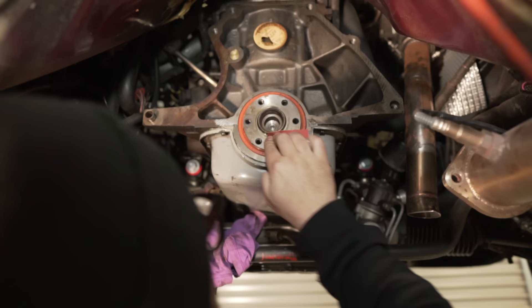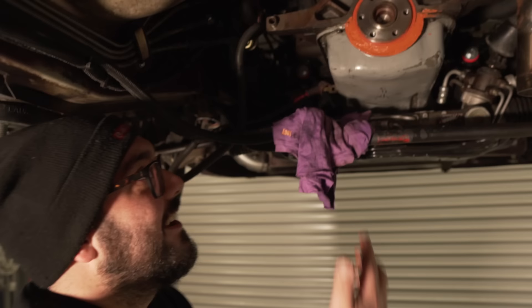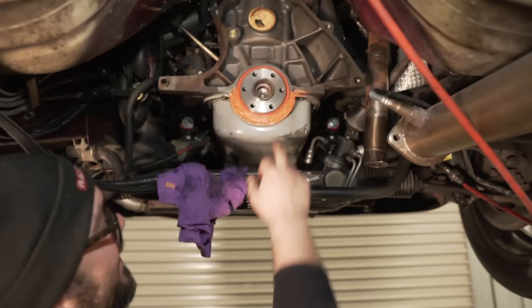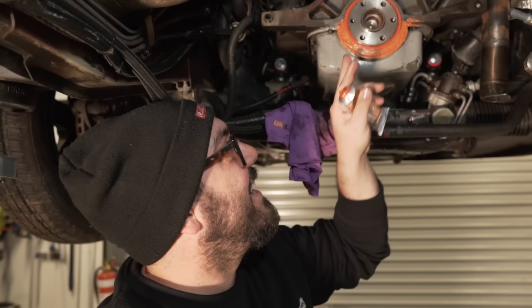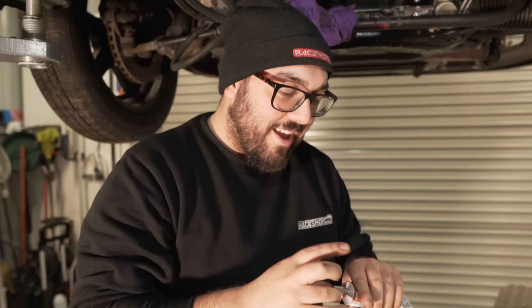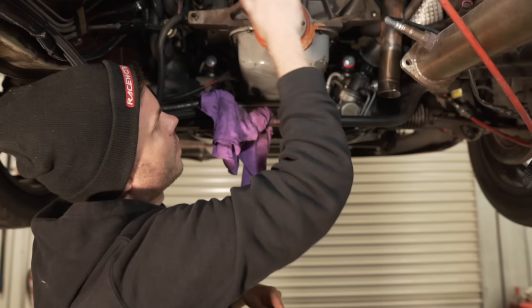I'm making a cake — it's called the 'no more rear main leak' cake. I like to use orange as icing. I did around the sump and was like, well I might as well just do one big hit around the bottom. The only thing it's gonna leak out of now is past the crankshaft. I've got a little more confidence putting more sealer on after seeing the back of Michael's engine — built by a professional — and when I asked him how much sealer he puts, he said 'seal the shit out of it.' So I committed to orange icing.